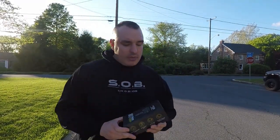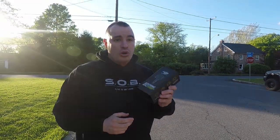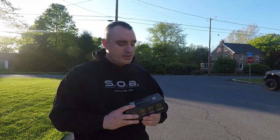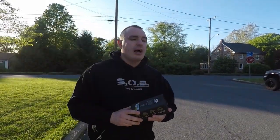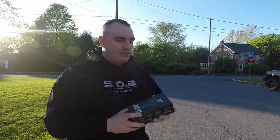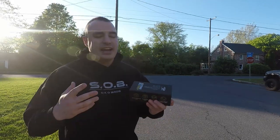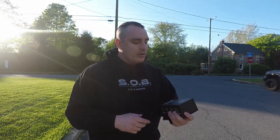I just wanted to take some time to talk about this. I've heard a lot of mixed things about this product on the market, but we're going to review it thoroughly — I'm going to run them. There will be several videos covering this product from Turbo Time once the truck is back, including install videos. They're super easy to install, especially on 6.0s. The 6.7 requires a bit more work because you have to remove the top intake. We'll go through it thoroughly with actual numbers — changes in boost and drive pressure — and aim for that ideal one-to-one ratio. You guys know how I review stuff: we don't doctor anything up, very honest reviews.